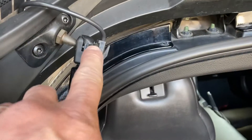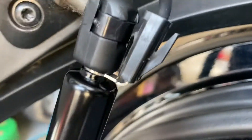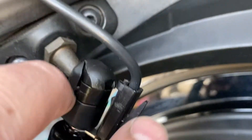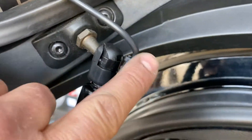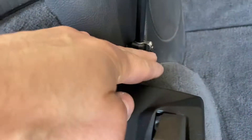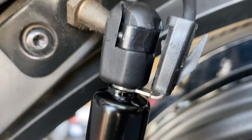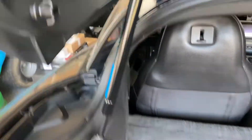The only thing you really have to do — you see this little pin here? This is a little tab, there's a flat. You see that flat right there? You just remove the connector first on top — you just push this tab and it lifts off. The bottom one just slides right off. For the top or bottom, you take a small flathead screwdriver and completely disengage this locking tab on both sides, and then you can pull the strut right off.